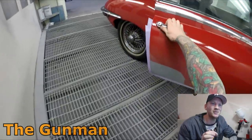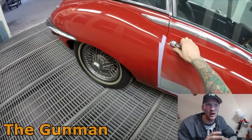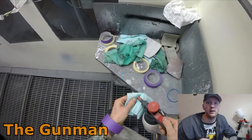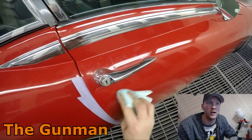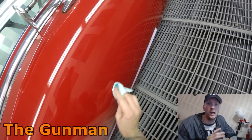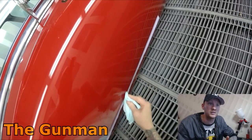As far as the prep work goes, I just sanded the primed area and then scotch-brited a little bit further out. You've got to make sure that the paint you're blending into is nice and glossy and shiny. As it turns out, the paintwork on this was pretty good — I didn't have to worry about polishing it as such. But if it was faded or dull you'd want to actually polish that panel prior to doing your paint work, so that you've got something nice to blend into.